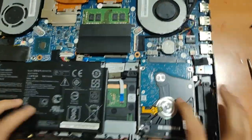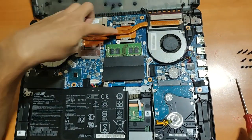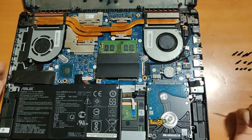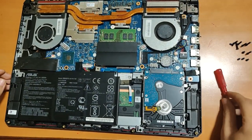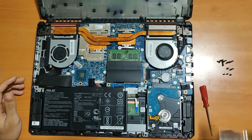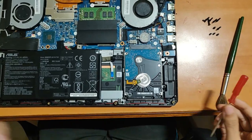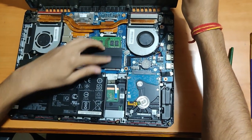You can see the battery pack over here, this is the HDD, and the CPU is over here — I assume that's the CPU or the graphics processor. The GPU will be over here. This other panel has the SSD, speakers, jacks, and ethernet cable. If you want to work on the HDD, there are some screws at the sides — remove those and you can replace your HDD.